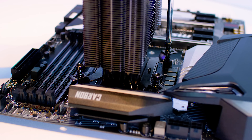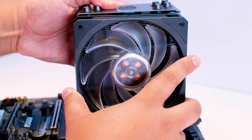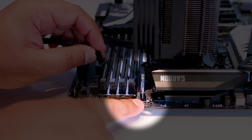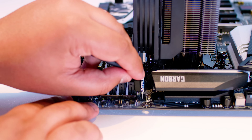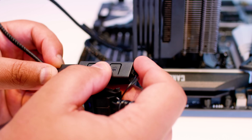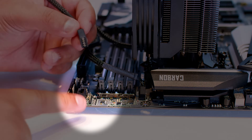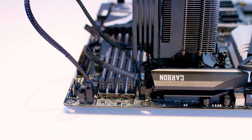Put the fan back on with a little push, locate the CPU fan header on your motherboard, and plug the PWM fan power connector in. Just like the 20XX socket, there are two ways to handle RGB: you can use the included controller, but I recommend finding an RGB header on your motherboard and plugging the fan straight into it. Once you're done, it should look a little something like this.